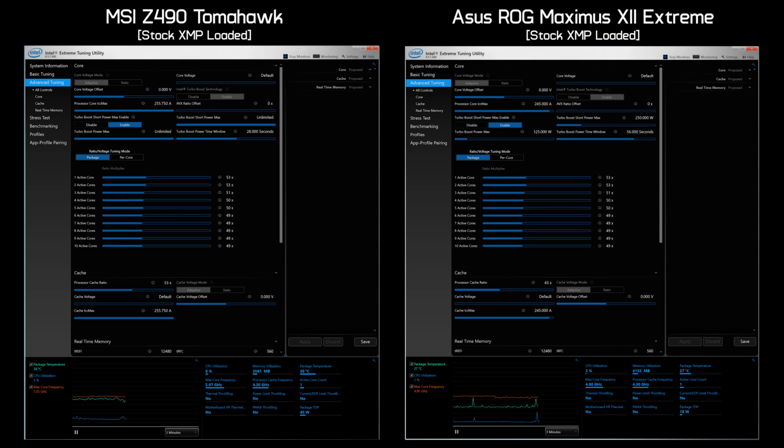Moving on to Rainbow Six Siege, and here we were looking at a 3% boost in performance for the 10900K over the 9900K, with a 5% improvement in 1% low performance. So, not exactly mind-blowing stuff, but as promised by Intel, the 10900K is now the world's fastest gaming processor. It was also just 6% faster than the 3900X, but with both pushing well over 200fps at all times, I'm really not sure how much that margin matters. Once again, 1440p helps bring everything together, and now the 10900K is just 3% faster than the 3900X, or 2% when comparing the 1% low results.